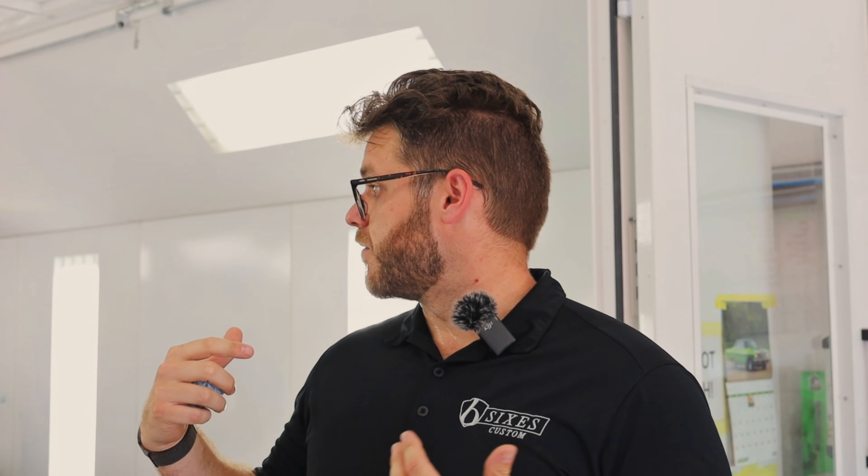That's what we do on all our paint jobs — my OCD. We try to strip everything down to absolute bare metal. I don't like sandblasting because it causes extra warping, which takes more time. I'd rather spend the time up front, sand it down by hand, really discover what we have, and then it gets acid etch primer, then epoxy, and we work on top of that. This is a driver quality build, not a show car, so we're not doing four extra steps of blocking or three to four stages of 2K.